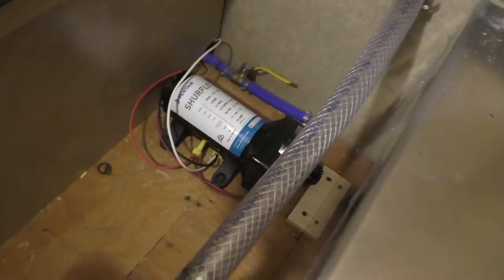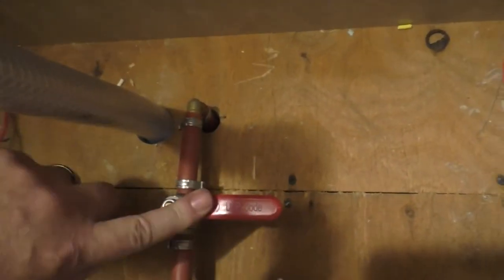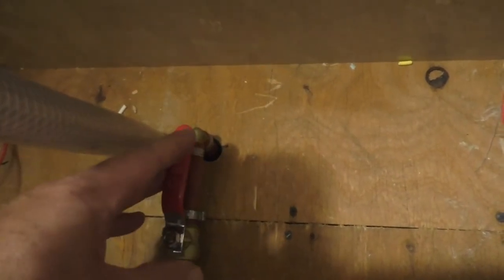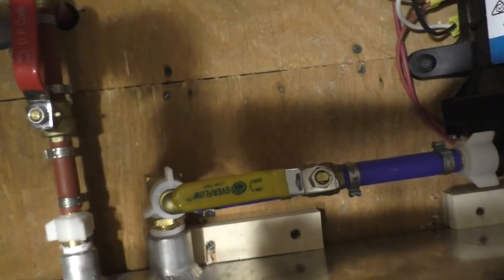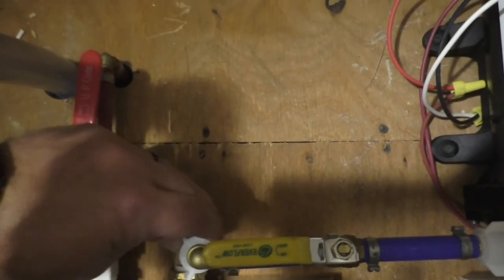In the event that you need to drain the tank, you turn your switch off at the vanity, turn this parallel, and let it drain out. It takes about 15 minutes or so, and you'll know because it'll stop running out. And then, if you need to take any of this apart, you don't need any tools — you can do all this by hand to tighten these off.